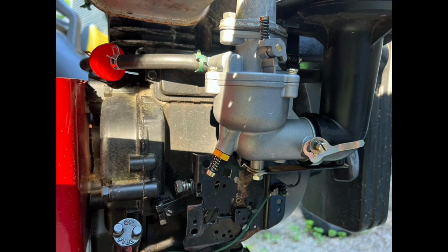We've already gone through that installation earlier in the video, and I think you saw some of the watch outs. Now when I went to start this up, most of these carburetors just plug and play. Mine was not idling properly. So the simple fix was on that main needle valve jet here that I've circled. Just about a turn and a half counterclockwise, opening it up, and you could set the idle right away. So if this doesn't work for you out of the box, adjust that screw and you can dial in the idle that you're looking for. And it ended up working out really well.